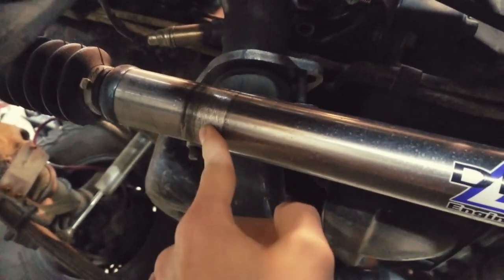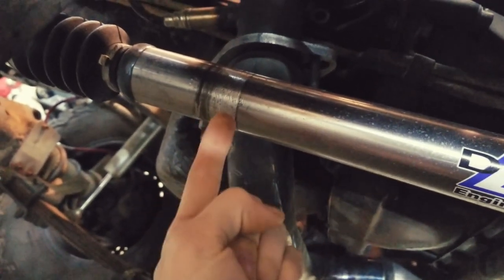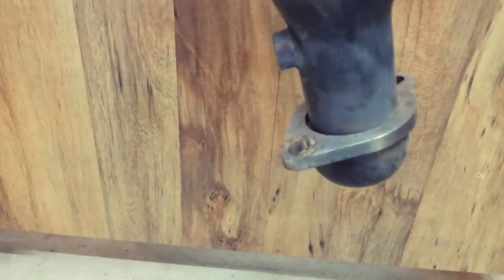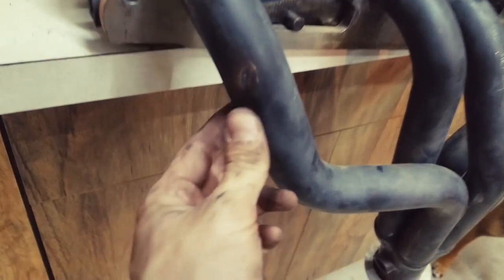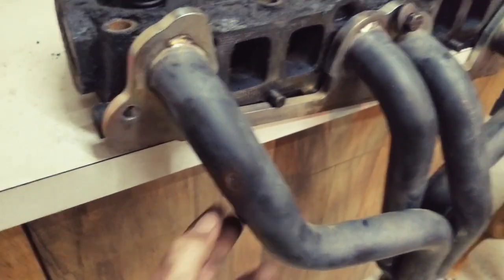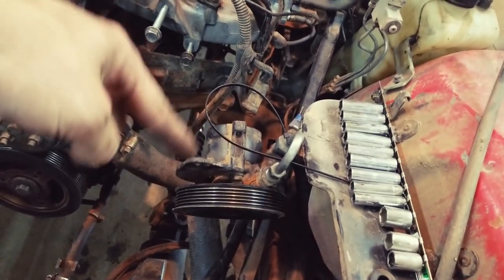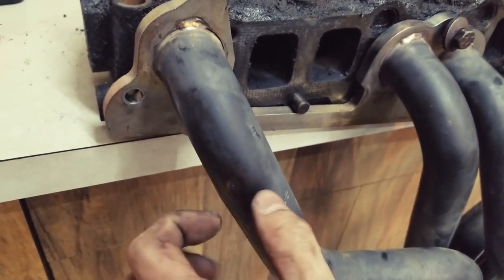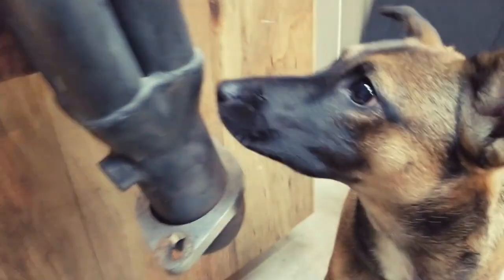You can see the drive shaft has been rubbing the exhaust quite a bit. It happens most often when this side of the car goes up — going over a rock or even around corners — it pushes this up and into that bracket. There's a lower one which is actually the one hitting. Aside from that, the headers do need to be hit with a hammer in a couple spots, but honestly a very impressive fit. There's a small indent from the intake manifold bracket — not a big deal.